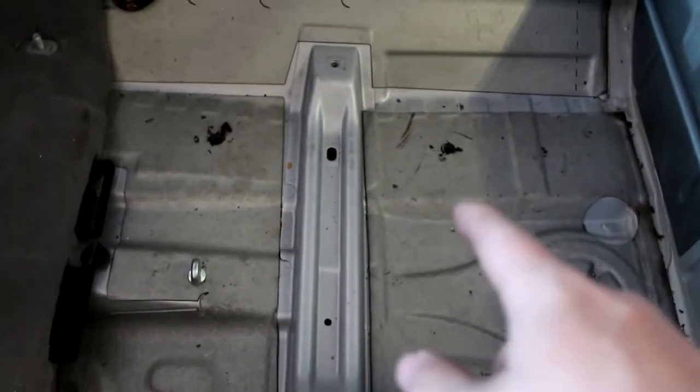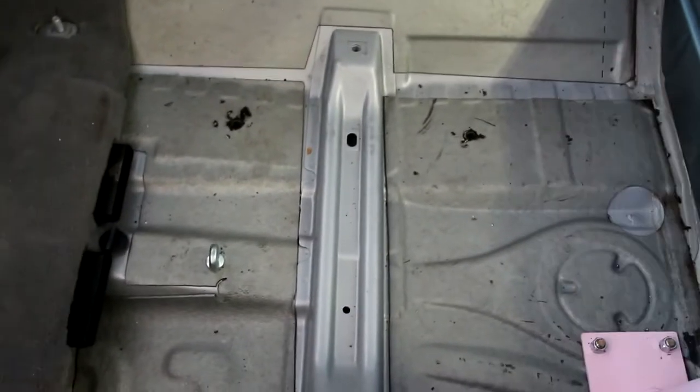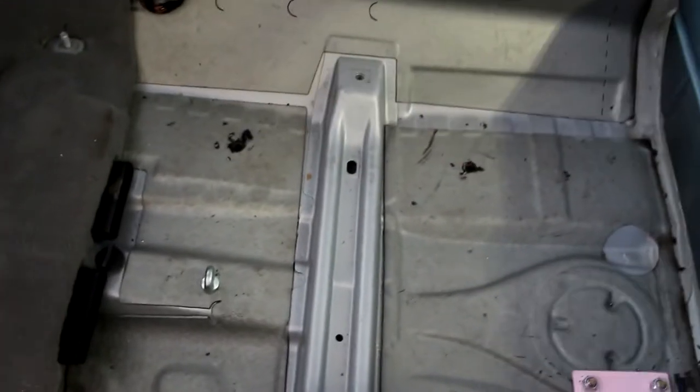I was able to clear both of those drills no problem. I was not able to fit the full half-inch drill bit underneath the car coming up, so I had to do three-eighths coming up and then came from the top with the half-inch to open up the holes a little bit more. I'm going to go ahead and spray paint the holes like I did on the ones for the roll bar so that they don't rust.